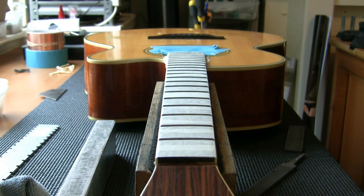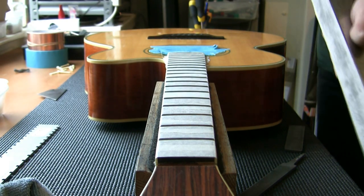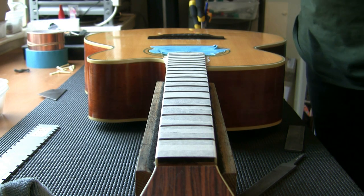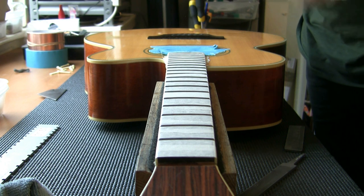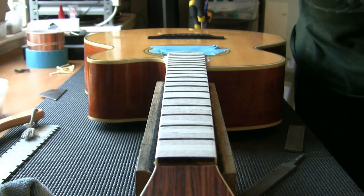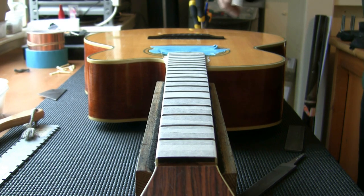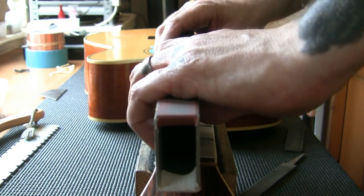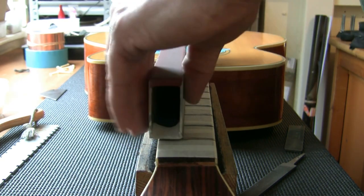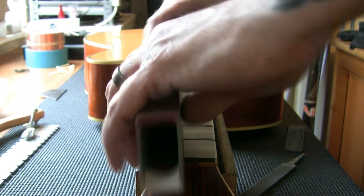But there you go. So now, I'll just clean this before I use it. I can just give it a brush, get the old rubbish off there. It's been there from the last time I used it. Good thing about a levelling beam is you can use it for 3 or 4 different jobs. Doesn't have to be super rough, as long as there's a bit of roughness on there, it will remove material. So, we should be able to remove this now pretty quickly, just a few strokes, not too many strokes. We're going to follow a radius. When we get to the edges, we're not going to lean out, we're going to actually follow a radius, so we're going to go all the way across, so we're always going to have it horizontal to the radius. So, let's have a look, see where we are.